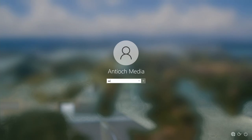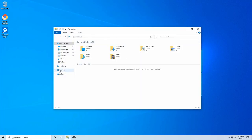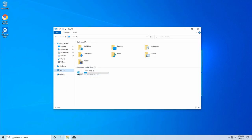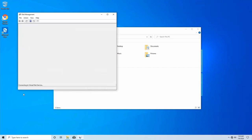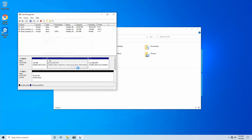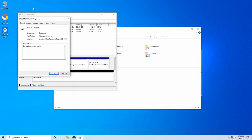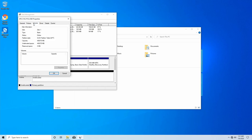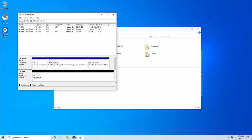Let's go ahead and log in. Maybe Windows will show it. Nope — but let's check one last thing. Maybe the disk just isn't showing because it's a brand new drive. Let's look under disk management. The disk is actually detected in Windows — not as a boot drive, but as a drive in Windows, yes. There it is: 512GB. That's the Silicon Power drive right there over PCIe. So this will work in Windows; I just don't think it will work as a boot drive because the BIOS doesn't see it at all.